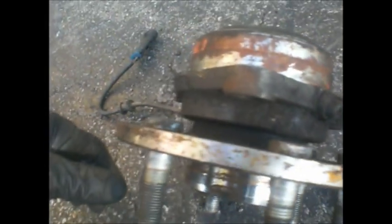You can tell when it's seated because the noise changes. Instead of sliding through the hole, it makes more of a ring and clang. They're all in. Yep. I actually bent the head slightly. You can't see it in the camera, but the head is touching where I hammered on it and not on the other side. So we'll tighten them up and then we'll retorque them after we get it installed with the wheel on.